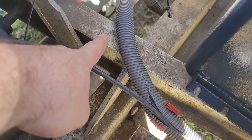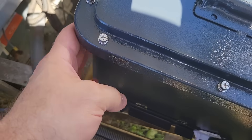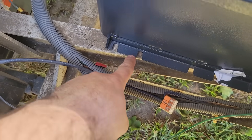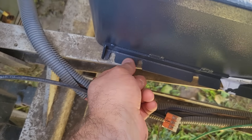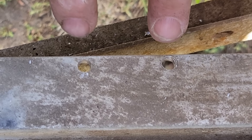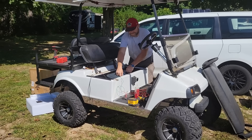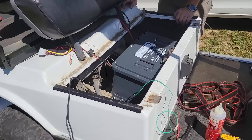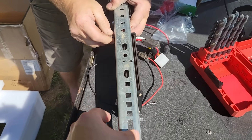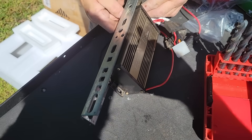The way this golf cart is built, it has two large aluminum I-beams running down at an angle. The lead-acid battery used to sit here. Since the lithium is larger, we set it on the flanges on each side — and it looks like we're going to clear. So at this point I'd like to drill and bolt into a couple of spots to make sure it's not going to go anywhere. We've got our holes drilled. This is with it bolted in place — yeah, the whole golf cart is moving. We're building a little mount to hold the converter and the solar charge controller on a piece of angle iron and then we'll mount that inside the frame.